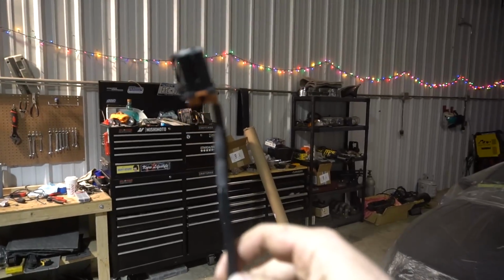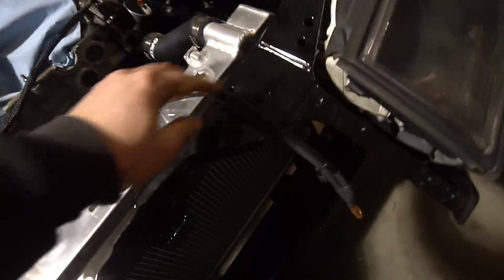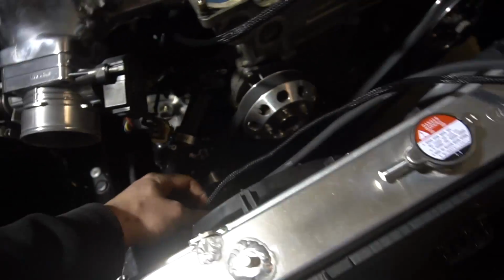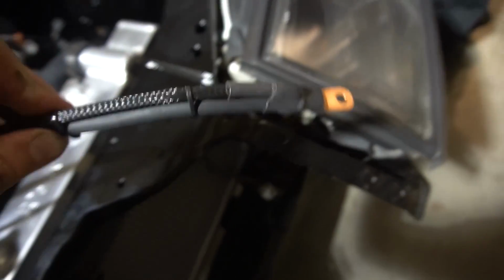But it'll look all nice with the wire loom, so they'll be all set. So this is just preparation for the battery wire, because this basically has to get power from that. Brian and I concocted this great thing. It looks a little bulky, but I put the chassis power harness on the end of the battery cable. We crimped it all into one crimp, heat shrunk it, and then have it zip tied together.